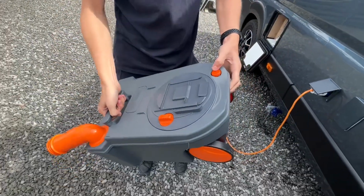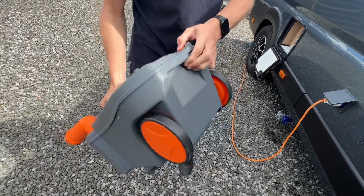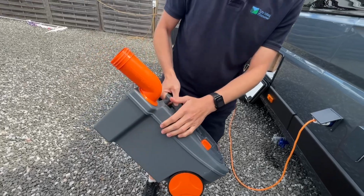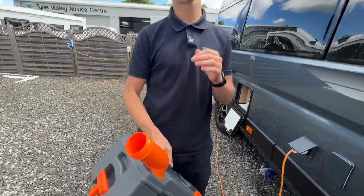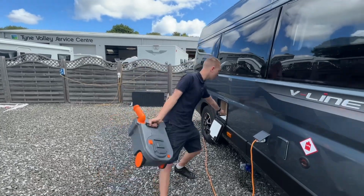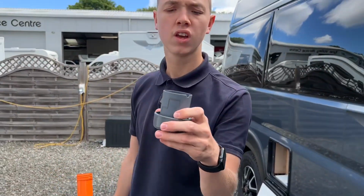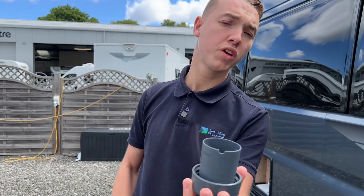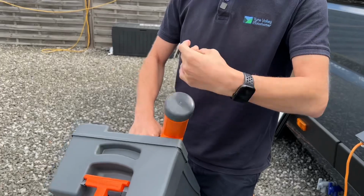starting to pour and pressing the orange button just to allow the water out and dispose of the waste. Once you've done that, there's normally a tap, so put some water in, give it a rinse and tip out again before going in where the cap comes back into use as a measuring stick, which is 120 ml of chemical. This can be green or blue, goes into here.